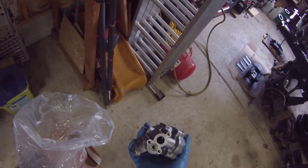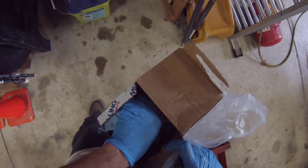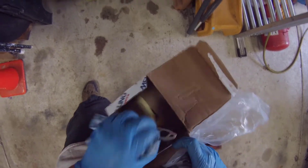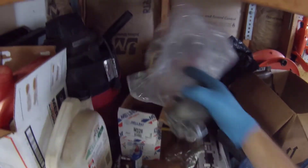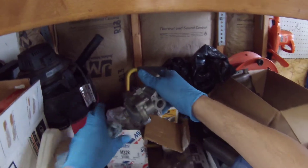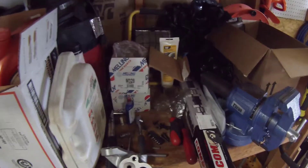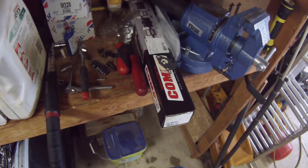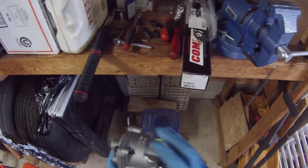So we're going to be putting on this oil pump and there's a gasket in here somewhere that it came with. We have two gaskets, the paper ones. Going over this, installing this oil pump - I am putting a high volume oil pump on, but with standard pressure. What that means is there's a relief valve, probably this right here, that if the pressure gets too great it will recirculate it back into the pickup, just so that you don't have too high of an oil pressure. And this is, I think, steel gears in here with that aluminum housing it looks like.